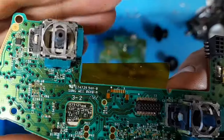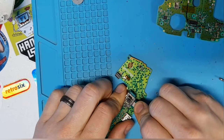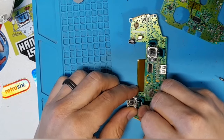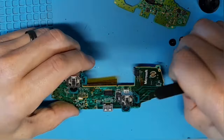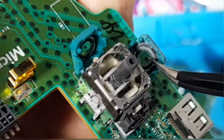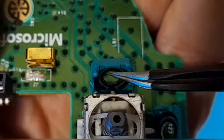The analog sticks had a bunch of dirt and hair in there — this is actually super common. Any moving part allows dirt and debris to slowly work its way in, and if you have pets, it's going to be hair. Dirt getting into these potentiometers on the analog sticks commonly causes stick drift. However, I have a sinking suspicion that this is actually going to be due to potentiometer wear rather than dirt. Xbox and PlayStation use the exact same analog sticks, and these potentiometers crack open like little tiny doors. What I'm removing here is essentially little wheels that turn back and forth so the system knows which way you're turning the analog. These wheels have metal on them which rub against conductive pads, and that's how it reads which direction the analog is facing. This is a good one — it's fully intact. But if we look at this one, there are some tears in it. Because the conductive pad is damaged, the signal to the wheel is interrupted and it reads as stick drift. That's it explained in the most simplistic way possible.